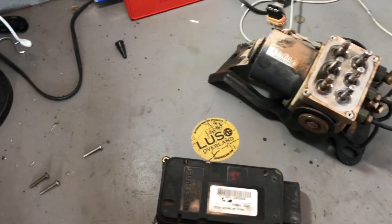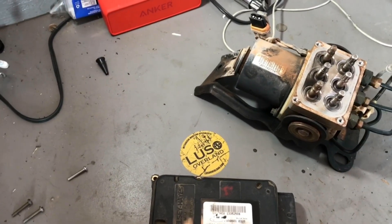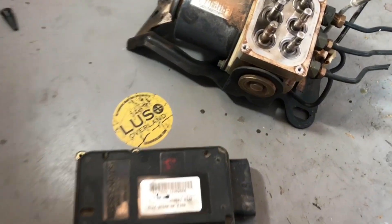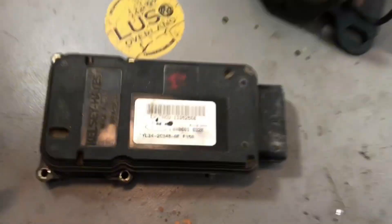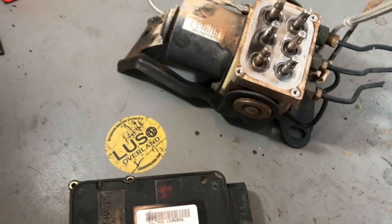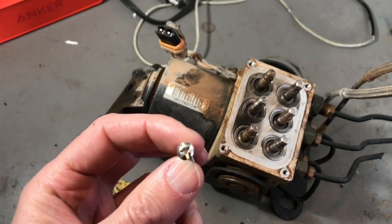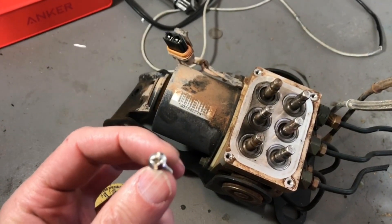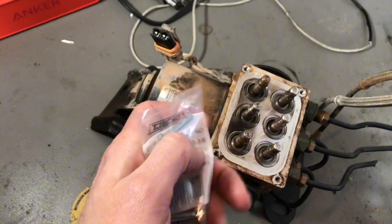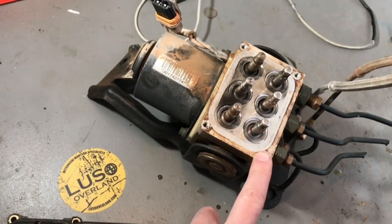So now we need to replace the hardware. What do you go with? It's an M4 by 25 millimeter. Some guys talk about them being rusted, but it turns out mine weren't rusted — the Torx heads just stripped out. But once I got the heads chopped off, I was able to spin them out by hand, no problem. Some guys switch out with stainless, but I didn't find stainless except in a slotted screwdriver and Phillips head combo. I decided to go instead with a hex cap so I can get an actual socket on there to give me enough torque. I'll probably put some anti-seize on that as it goes in and it should be fine.